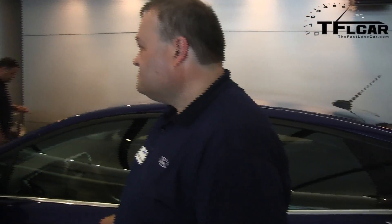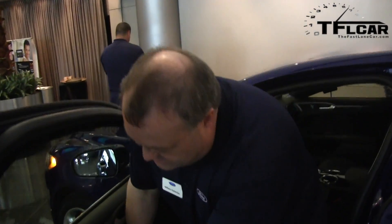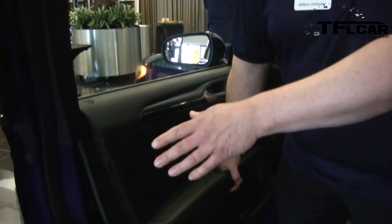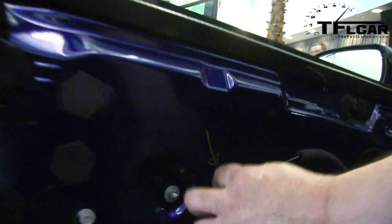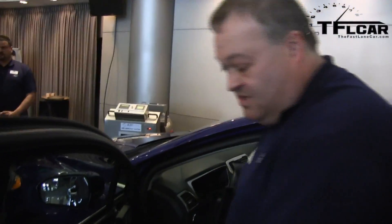It's a very warm car — heated to about 120 degrees. Here's the door panel — these don't come off this easily normally, so don't try this at home or you'll break your panel. We removed it and you can see here's the hole: this grommet is not installed properly. The hot air goes through here, heats up the outer panel, and we detect that on the thermal camera.